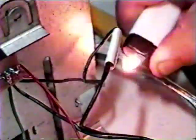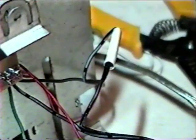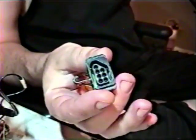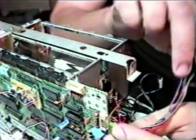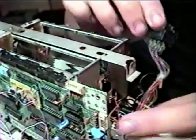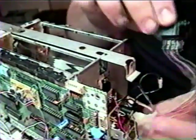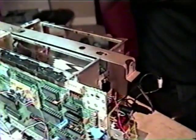The tubing can be shrunk down using a heat gun or lighter. See, I told you we'd need a lighter. I'll bet you thought that I was bullshitting. Now let's tackle an issue you'll probably have with the controller ports. You may notice that the wires on the controller ports aren't long enough to work with your toaster design. If this is the case, simply cut the wires about halfway down and use spare lengths of wiring to splice them back together, isolating each of the splices from each other with black tape to prevent shorts.